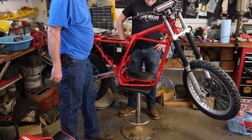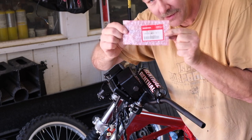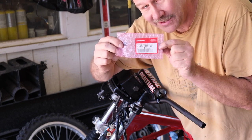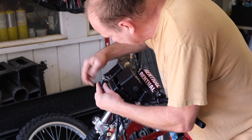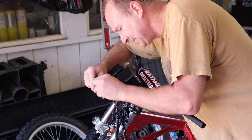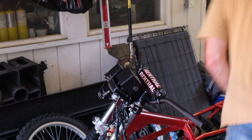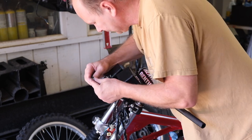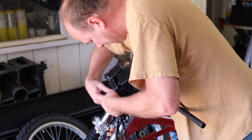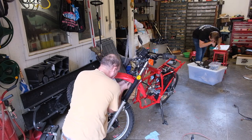Almost forgot - we could have been going down the road and the whole rear end fell off. There's a bad bulb, so we are putting in an OEM speedo bulb for a 1983. While I have it apart I should change both bulbs so I know they're both done at the same time - this one's still good but I'll change the other one. The speedo lights, since they are so hard to get to, will be brand new bulbs. You have to put them in before you put the speedo in, up through this bracket that holds the headlight on.